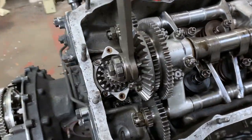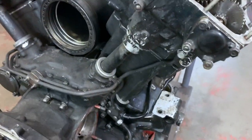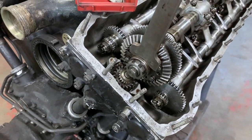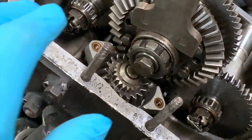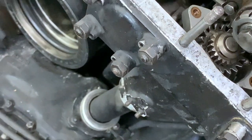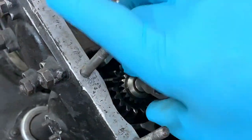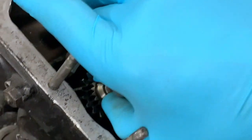When you've got to that position, this is dead simple — you've got a spline shaft driving up from the wheel case down here, and it has a different number of splines at the bottom and at the top. So it's a vernier shaft, and basically what I can do is drop it in — it should go in in one particular position. So without moving the camshaft I'm just going to keep on turning that and trying to drop it in one tooth at a time.